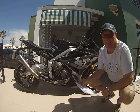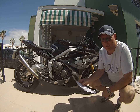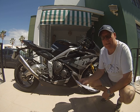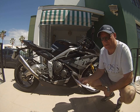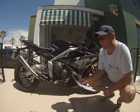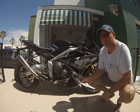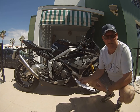I've managed to make a right mess of my preload adjusters, because they're the lovely blue anodized ones — I'll show you before I finish the video. I tried tape around it so it didn't take the coating off, and I used an adjustable spanner for more turns without having to take it off and put it back on. But I've managed to scratch up the coating. The anodized parts always look lovely but the minute you start adjusting them the anodizing comes off, so really they may as well leave them in standard silver.